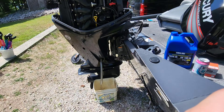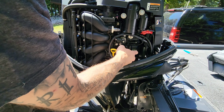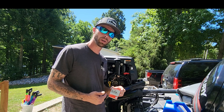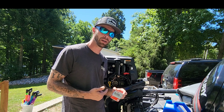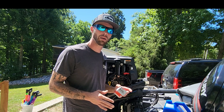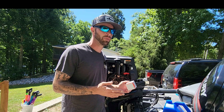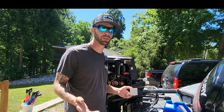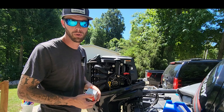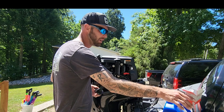While that's draining, we're gonna go ahead and remove our filter right here and put a new one in. You're probably wondering why a Yamaha filter is going onto a Mercury outboard — it's because this is actually a Yamaha. All the boat manufacturers — Suzuki, Tohatsu, Mercury, and Yamaha — they take turns building certain slot motors. Instead of each making two dozen motors from a 2 up to a 250 or 450, maybe Suzuki builds the 2 through 30s and Mercury builds the 30 through 90s. This 2015's powerhead is identical to the Yamaha; they just slap the Mercury sticker on it.